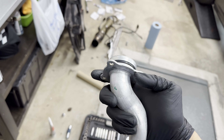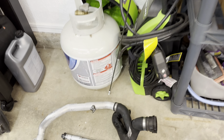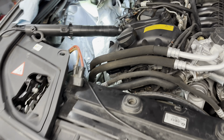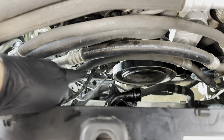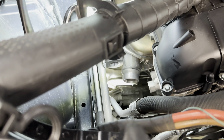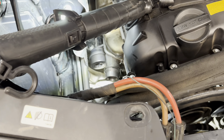I got a new O-ring and new bolts for it as well. I finally got the thermostat-to-water-pump hose out, separated from the water pump — that was not a fun job. There's the water pump. I basically moved it from here and rotated it upwards, and it's sitting right here now. I just need the water pump out of my way so I can get a more straight shot towards that one bolt of the motor mount bracket that I still can't get to.